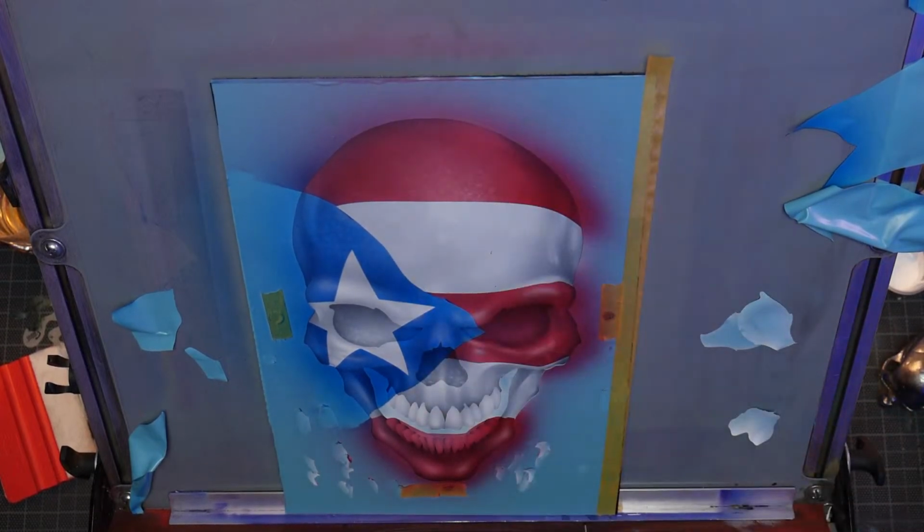Do you prep your panel first by scuffing only? Yeah, so what I do is the panel itself was hit with 400, and then I put the Autoborne sealer on that. I let that dry. I scuff that back, and I take off any dust nibs or anything in it. Then I put the base color, in this case the flake with the 4050 in it, put 2 coats of that down, and then I put a single coat of 4050 just to protect the flake so I could scuff the flake down without scratching the flake.